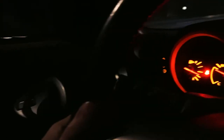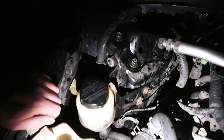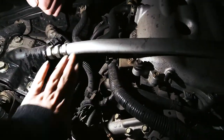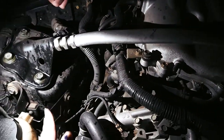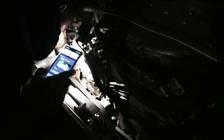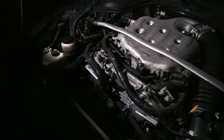All right, brand new radiator and we're immediately overheating. Back to the garage. There's coolant splattered everywhere but I can't really tell where it's coming from. There's no shortage of hoses on this car. According to the splatter pattern, the culprit is probably somewhere in this area. Regardless, I'm going to have to wait for it to cool down and get it back in the garage.